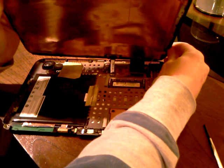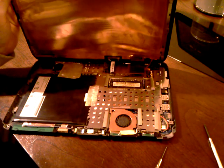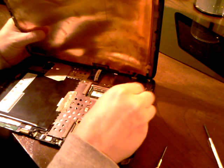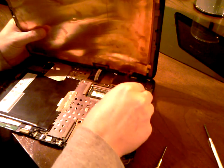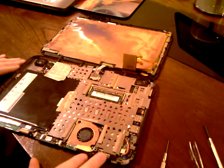Now be very careful of these ribbons — especially the USB. There are two little clips just here; they are just little ribbon clips. So you just want to flip them off and pull the ribbons out. That makes it a little bit easier so that you can flip it over and not have to worry about it.